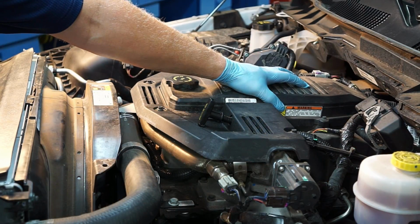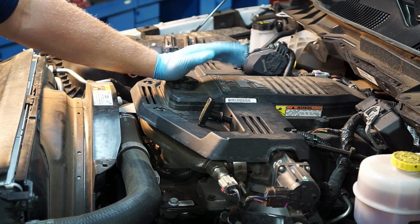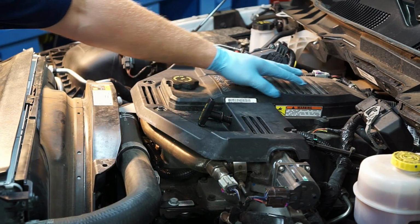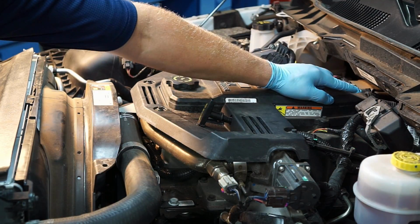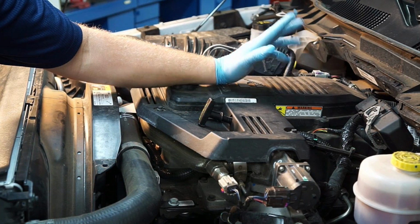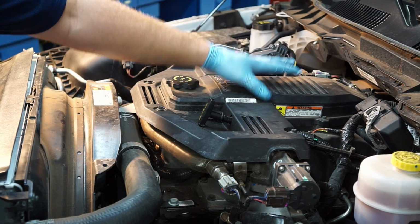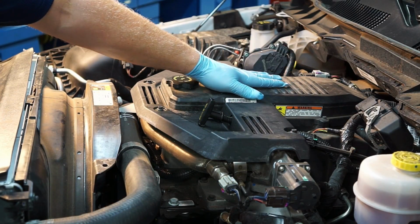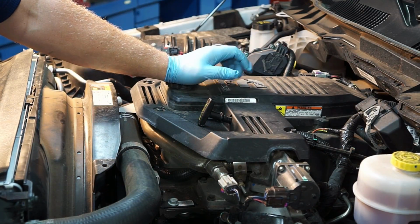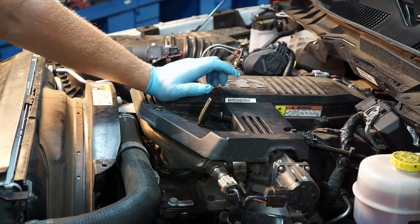We've got a filter built into the valve cover here. This is a serviceable filter, so if you're doing something like a turbo replacement or anything like that, it's important to replace the filter in here. And now the PCM can tell if there's no differential. Obviously, somebody's eliminated the filter. Not a good thing. The check engine light's going to turn on. Or if there's too much pressure differential, that indicates to us that we've got a restricted filter. And that's going to start drawing more oil up out of the crankcase, and also may mimic a faulty turbo.